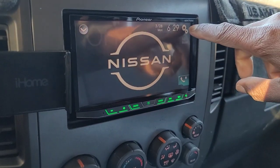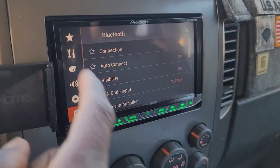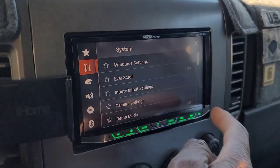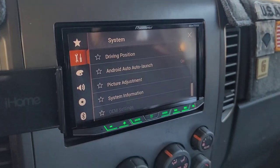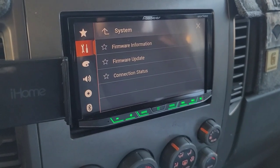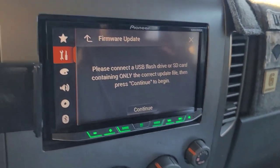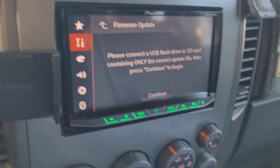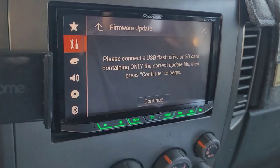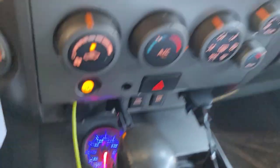Press the home button. Then hit this, go to tools, go all the way down, and hit system information. Then hit firmware update. The prompt says: 'Please connect a USB flash drive or SD card containing only the correct update file, then press continue to begin.'